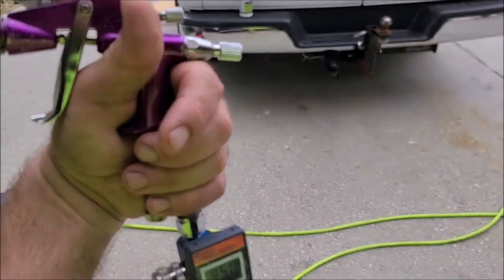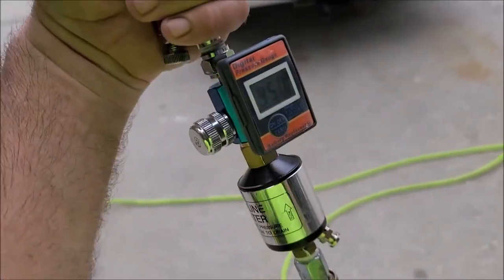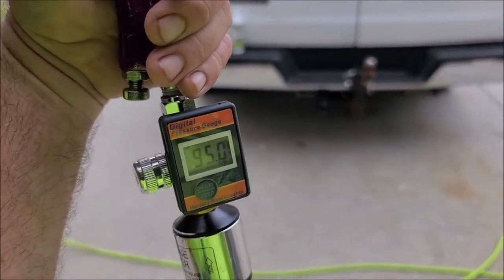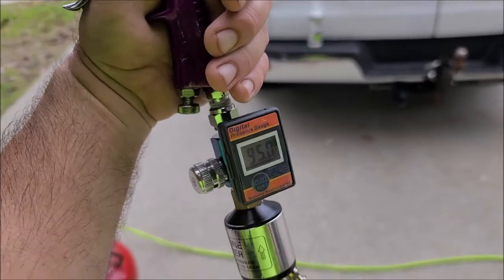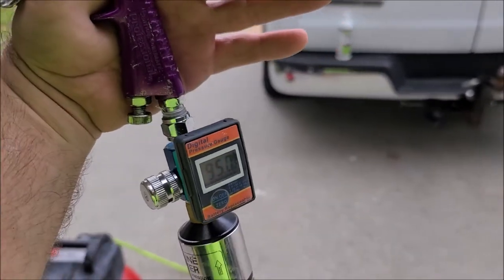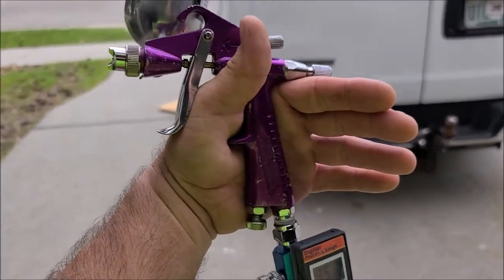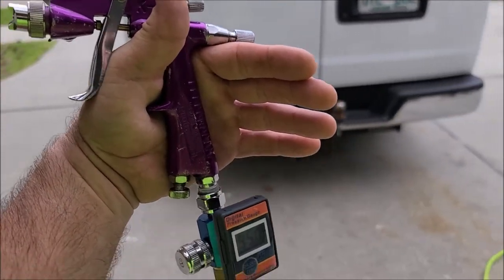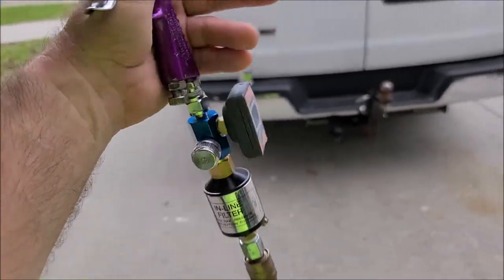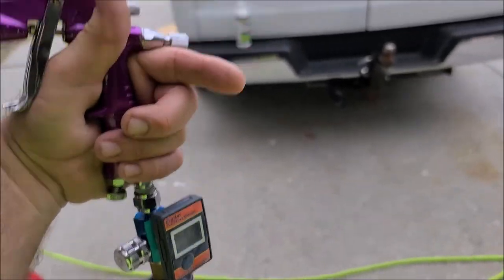You really have to do your own research on how it flows per your liking, but anywhere from 25 to 50 PSI is good. This stuff only needs a very light coat — you don't have to soak it; it doesn't need to be dripping when you're done. You just need all of the parts to be coated evenly. Even coverage is really what I'm getting at.